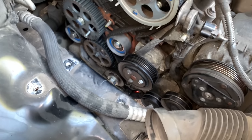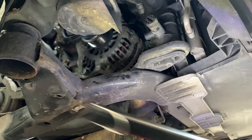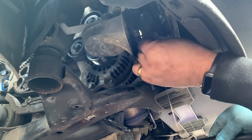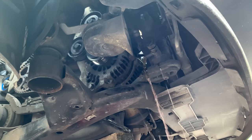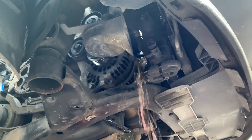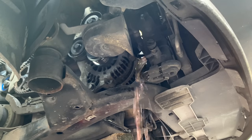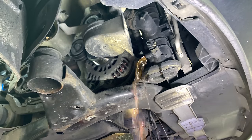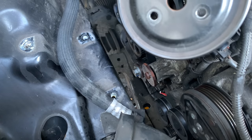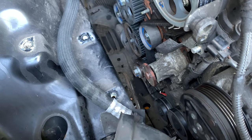So we can go ahead and remove the water pump now. We've got to empty the cooling system and we've got a very convenient little valve here — let this thing drain. I'm going to open the reservoir at the top. So the water pump — I already removed the pulley, had to hold it and break the 10mm bolt. So that wasn't too bad.